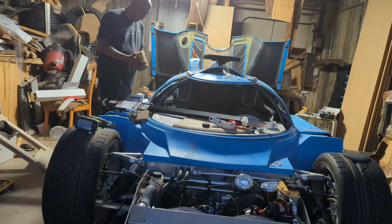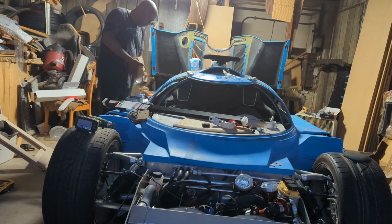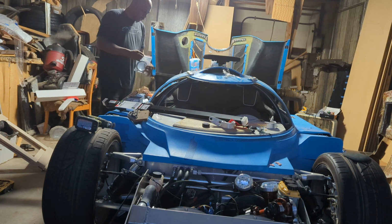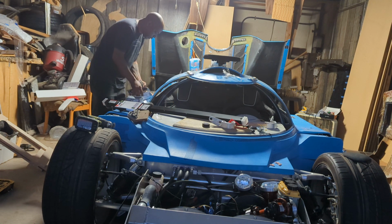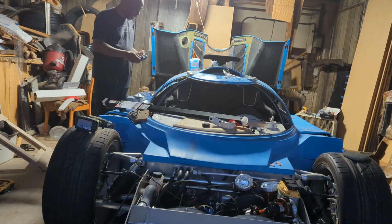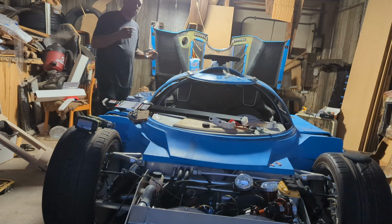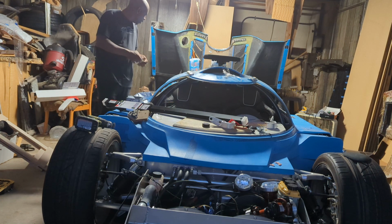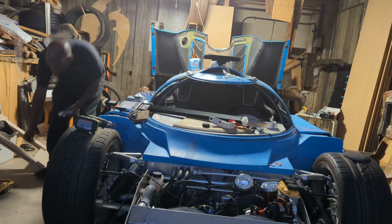Originally, when I first walked up on the car to buy it, I was like, man, what's kind of weird on this exhaust? It appeared to me that we would have had some back pressure issues, because the air coming out of either side of the exhaust was literally being fed into each other. That shouldn't be. You're putting pressure on your valves, and it's like turning your tailpipe backwards, just plugging them up together. It was really like that. So we changed that, and I'll show you how in just a minute.